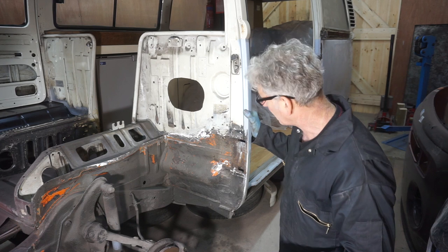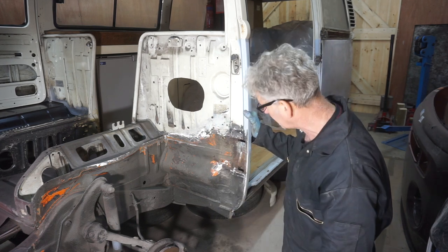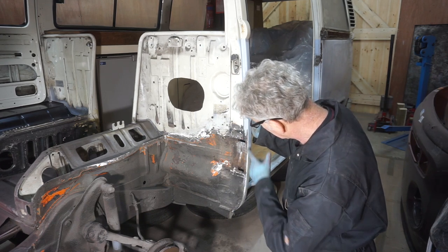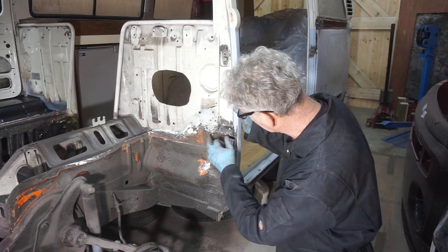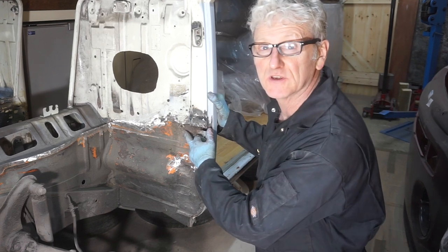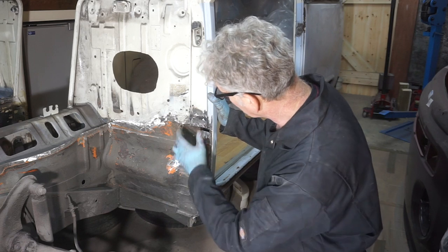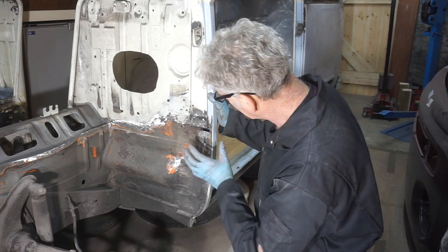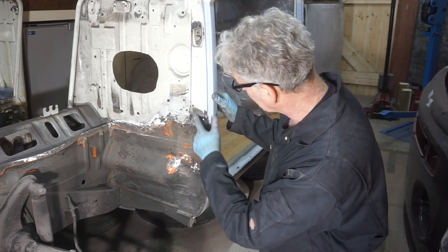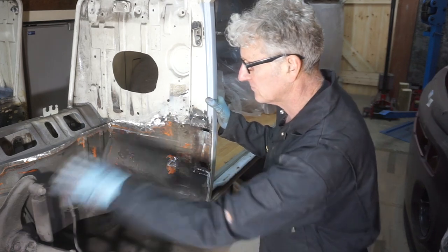Next job now is to sort this area out. It's nowhere near as bad as the other side, but I need to replace this section here, which has got a hole in it, and someone has very crudely welded in a big nut here. Presumably it must have been something to do with safety belts. So I'm going to cut all of this out, replace it with new, and also tidy this area up as well. Then I can fit this seat tub